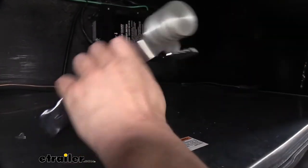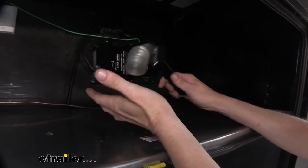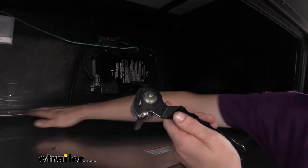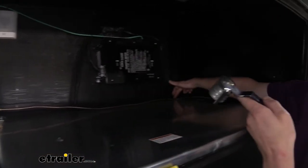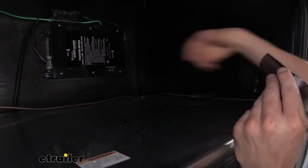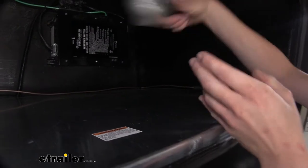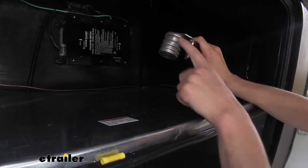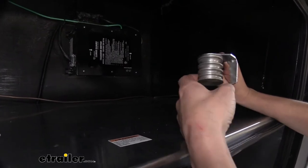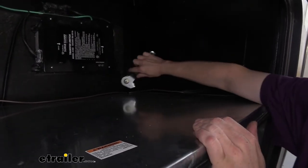You can get these at E-Trailer. This is a line bending tool, which is not strictly required, but if you want a nice layout on your lines — going straight over and then putting a 90-degree turn in it — you're not going to be able to do that just by bending it with your hand. What will happen is you'll end up kinking the line, and then the line's useless and you'll have to replace it. With a line bender like this it wraps the line around the groove's diameter, which prevents kinking and gives you that nice clean look. We'll be using this at several points.